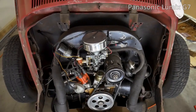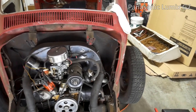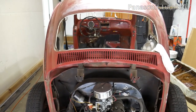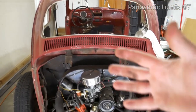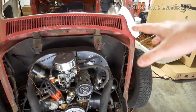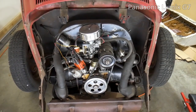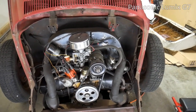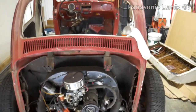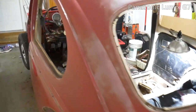So I gotta go out and buy some wood and rig up a system that'll help me lift up the whole body and then put it up on stands so I can just roll out the pan. I don't really need to clear anything. I don't have a rear apron, and that's really the only thing that would have to clear the engine. So technically, I'd only have to lift it up maybe about 6 inches to a foot, but I'm still gonna probably get it up a little higher than that so it'll be comfortable to stand inside it and work on the inside.